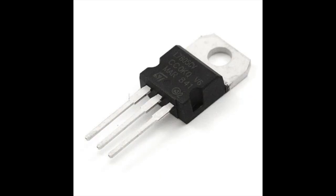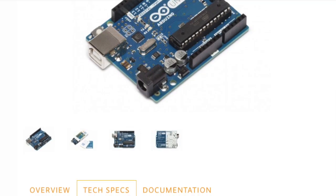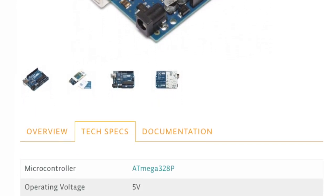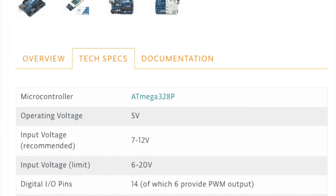On the other side there's another screw shield. For power input, the Arduino runs on 5 or 3.3 volts, so I had to add a 5-volt regulator since the truck is 12 volts. The Arduino could run on 12 volts via its built-in regulator, but it's not recommended above 12 volts, as vehicles run at 13 to 14.5 volts when the engine is running and charging the battery.